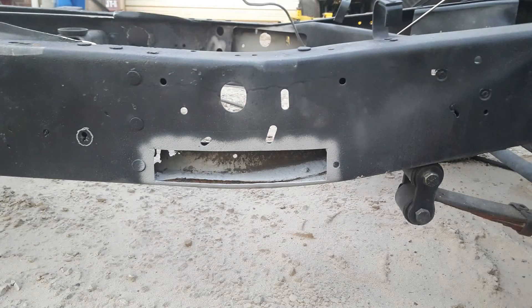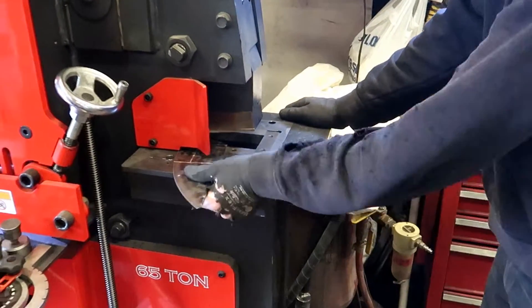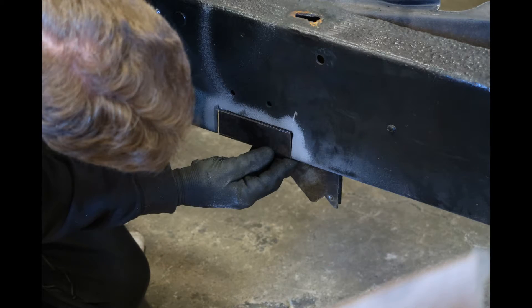We've got the engine over at the machine shop. We've fixed a few things in it, waiting on some parts. The next thing we decided to do was to tackle some rust in the chassis. There were a few pockets where debris was held and it rusted through. So we took it over to my buddy Alan Pizzo's shop at Predator Racing and proceeded to cut some bad pieces of chassis out. We used his very cool Edwards Iron Worker to produce replacement parts with the proper curvature and size, grafted them back into the chassis, and ground everything down to make it look like it had never happened. The chassis turned out phenomenal.